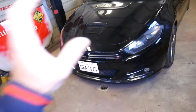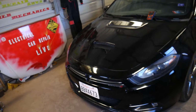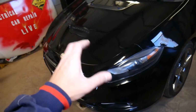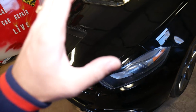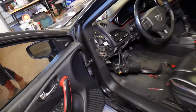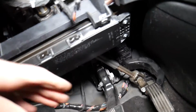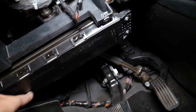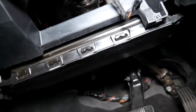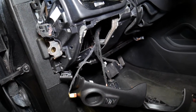So first, we have our car battery disconnected. Go ahead and disconnect your car battery. You can search the video on our channel for the correct way to disconnect a car battery. We'll explain how to do that. We have it on a Dodge Dart. Once you do that, we have to take that panel off. That panel needs to come out so we can actually access the airbag. Stay with us, we're going to do that and get to the driver's side knee airbag. Our car battery is disconnected. I'll remove that panel, and we'll continue.